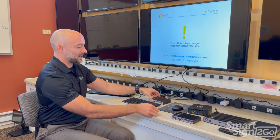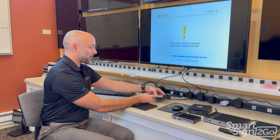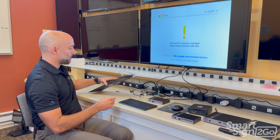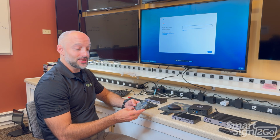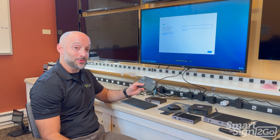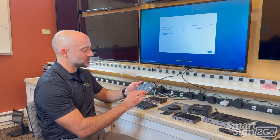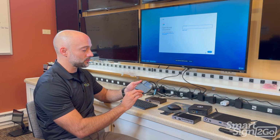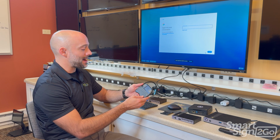From this point, we can start with our keyboard. So whether it's a wireless keyboard with a little USB receiver, some of these will work. It needs to be compatible with Chrome. Otherwise, a good old-fashioned wired keyboard will almost always work. For these procedures, if you're going to use the keyboard mouse combo unit that came with your player, if it's one of the newer players where we shipped out a keyboard with it, the keyboard actually has two Alt keys. There's an Alt key and there's an Alt-GR key. So when we talk about steps for the power washing or for exiting out of the app launch process, you want to use the Alt-GR key. So just substitute that in when you're trying to use that keyboard, and that should work fine for you.